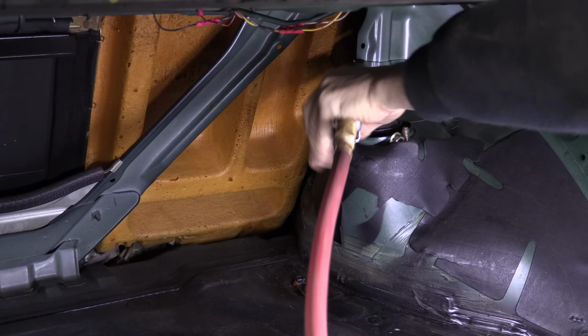The front sway bar lets go pretty easily with only four 14mm bolts. Same goes for the rear steering rack with only four 17mm bolts. I sincerely regret not taking those tie rod ends loose from the steering rack when I was under the car. Lesson learned.